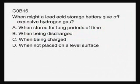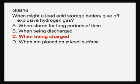When might a lead-acid storage battery give off explosive hydrogen gas? A lead-acid battery gives off hydrogen when it's being charged, and it's important that it be well ventilated while it's being charged. Some sealed batteries have solved that problem to some degree, but your ordinary lead-acid storage battery that has vents on it needs to be in a ventilated area when it's being charged.